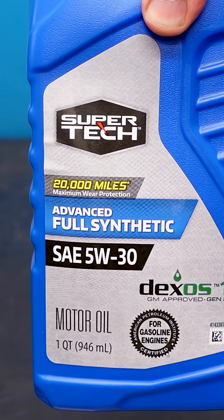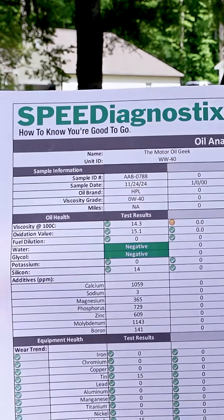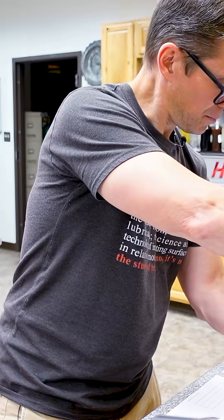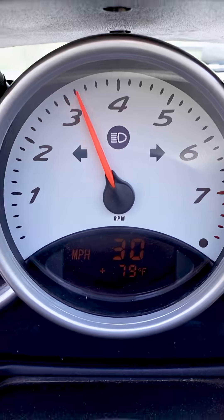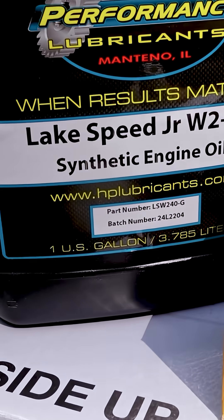But we want to go a little bit different — we're going outlaw here. So based on the test results from those 5W30 oils and the used oil analysis from my car, I've got a formula that I'm going to share with you right now to make a 0W40 full synthetic oil for the Wombat. Here's our not-so-super-secret outlaw engine oil formula we're going to blend up. We've got 4,600-something miles on the Boxster with that Pennzoil 0W40, so it's a perfect time to do an oil change, put in our Walter White-inspired 0W40 oil, and take a sample of that Pennzoil 0W40, which we'll show the results in another video.